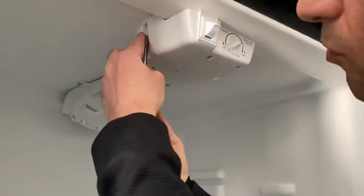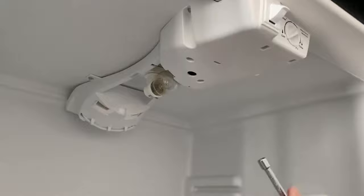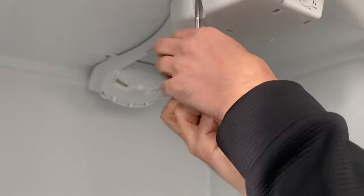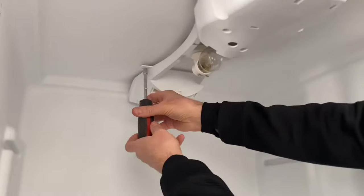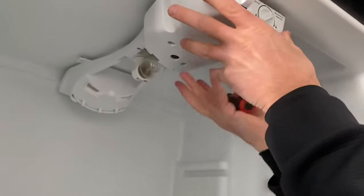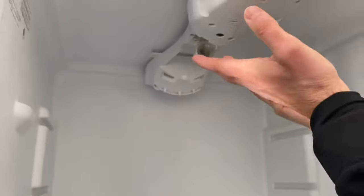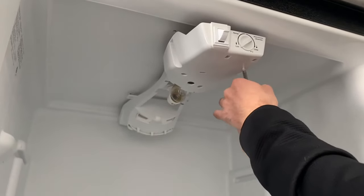So with our socket wrench, there are four bolts total — two at the front and two bolts in the rear, one on each side, so we need to undo these. I like to undo the rear bolts first and leave one front bolt so that it still keeps the assembly in place, because this assembly has a little nipple that goes into a hole in the back wall, essentially holding itself in place until I'm ready to take it out. So I take the last front screw out last.